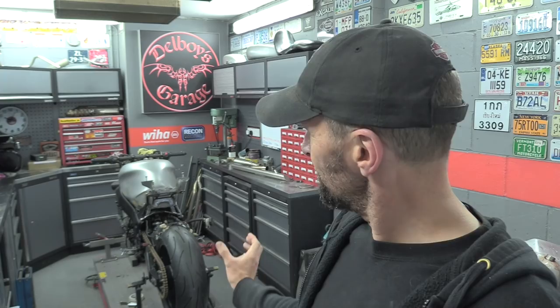You can buy oval piping. So if I mount an exhaust under there, I have to have the heat shield. The heat shield will be the under tray, and effectively that will have to cover everything, including the mounts for the top panel. So if I bolt that up from underneath, I then won't be able to get to the bolts, because I'll have to cover everything from underneath for purposes of weather and obviously heat from the exhaust. So that is the thinking, folks.